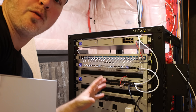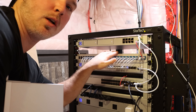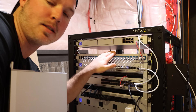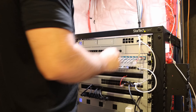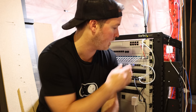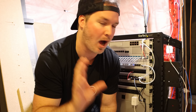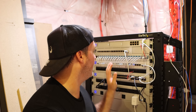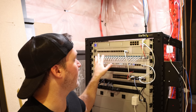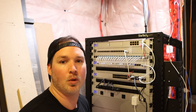Most of you have seen my network rack before — don't judge too much as it's a little messy. Things change all the time here at MacTelecom Networks, but we're going to put this 16-port switch in the second U as that's open, and I'll be using rack studs to mount it. Unfortunately, I don't have a super long DAC cable — just a 0.5-meter DAC cable — so we're going to have to run it across instead of through my wire management, but that should be fine for now. I'm going to move some of these data cables up to the 16-port switch, taking them out of my 24-port switch and bringing them up to the 16. Then we'll look at the cool EtherLighting.